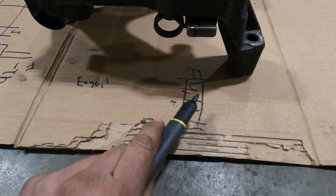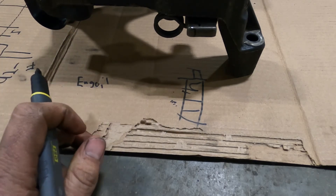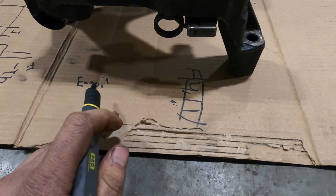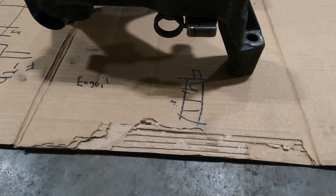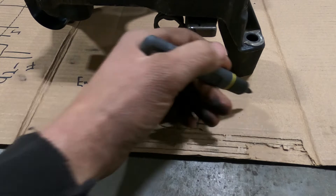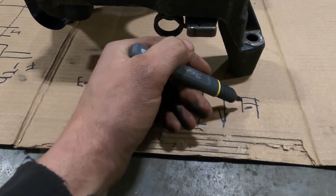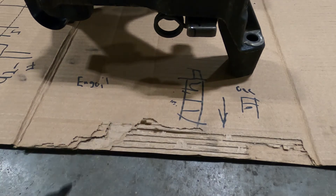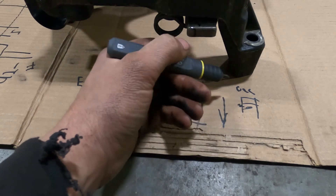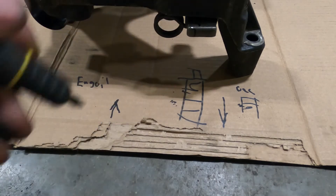To fire the exhaust valve — so this whole device, the entire apparatus, all it does is fire the exhaust valve near TDC of compression. What does this do? It releases all the built-up compression that would have normally been used to fire, which is what creates that large pop noise through the exhaust, and dumps it all out. Now your cylinder is at zero PSI and traveling downward, so it actually enters a slight vacuum — all of it absorption of energy. And if nothing else, even if it doesn't enter vacuum, it's not going to have the pressure that was created from compression pushing it back down.